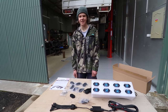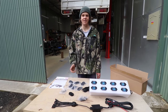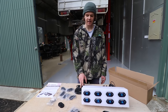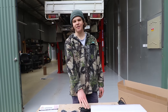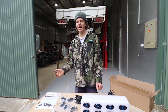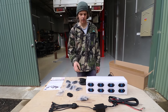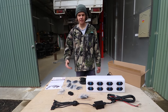The hardest part is figuring out where you want to put them, and that's the task we're challenged with today. These are fully waterproof and weatherproof — they've got waterproof seals on all the connections. Being rock lights, they're going to get covered in mud, silt, and you don't want anything getting in the connections. The lights are all fully sealed and look pretty sturdy. The kit does come with a lot of wiring — cables varying from about 3.5 to 5 metres — which caters for any needs, like running a cable from a rear-mounted battery to a front light. We'll need to do a little cable management with cable ties, but it's better than having to extend cables and gives more versatility in placement.